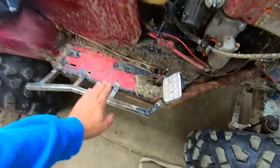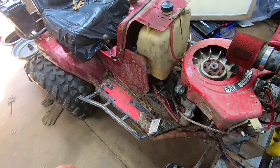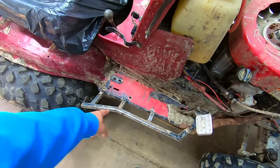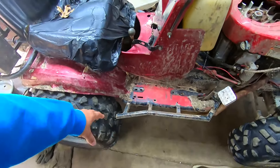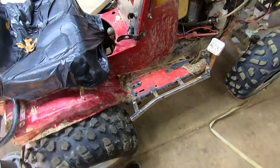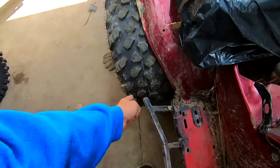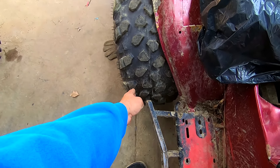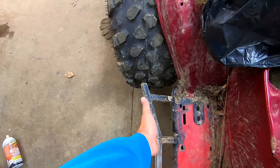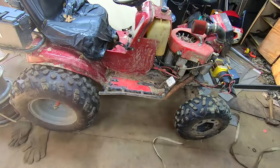Tree kickers — these are an absolute must if you're doing tight, twisty trails like we like to do. You need to have those because what ends up happening is a small tree comes right in here on the tire and it just wants to suck it in and you can't get around anything. This is a lot wider than I usually have it. The swamp tires usually come out to about here, so the tree hits this and just rolls off the edge of the tire and you can get around stuff a lot easier.